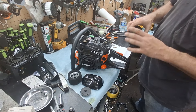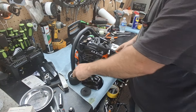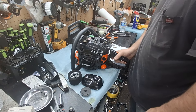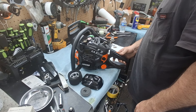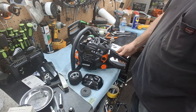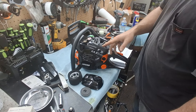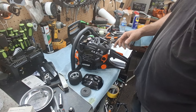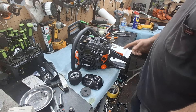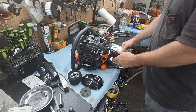On a positive note today, my Honda filter came in. I cut a chunk off, already oiled it up, and it fits my cage perfectly. I had to tweak my throttle rod in this one — it was being a little glitchy. It still makes a little click. Watching it, when it starts to move, the rod thumps over. When I was pulling on it for a compression test when the recoil acted up, the rope did flip over and catch something and it might've caught the throttle rod and bent it. Went in there with a screwdriver and bent it back, and now it feels almost like my other one.